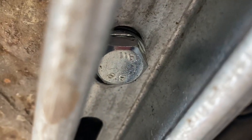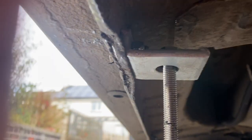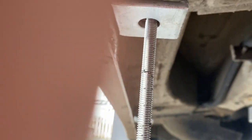Out of the van, there is the short piece of unistrut cut and bolted to the chassis into a couple of M10 rivnuts. If you think you need a huge tool to fit that — no, you don't. There's a link in the description for an Australian guy who has a super cheap method of fitting big rivnuts without buying an expensive tool. Down at the front, a couple of heavily galvanised bits of angle iron trimmed down to fit the sill and bolted through from the outside with stainless steel nuts and bolts. There's the supplied M8 bolt poking down, ready to be mounted to the step itself.